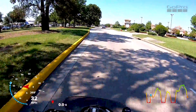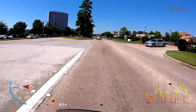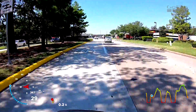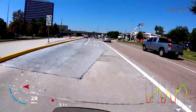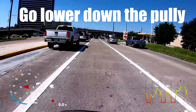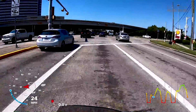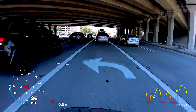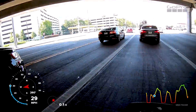Let's reiterate: the 835 was a shorter and skinnier belt, and what does that create? That creates the ability for your belt to not travel so high, giving you more torque and more takeoff. From a dig, that's what you want, or if you have a lot of hills that's what you want — you probably want that torque more than the speed. Of course you always have to adjust the weights too — I've got 12-gram weights in here right now, I may try 11-gram.